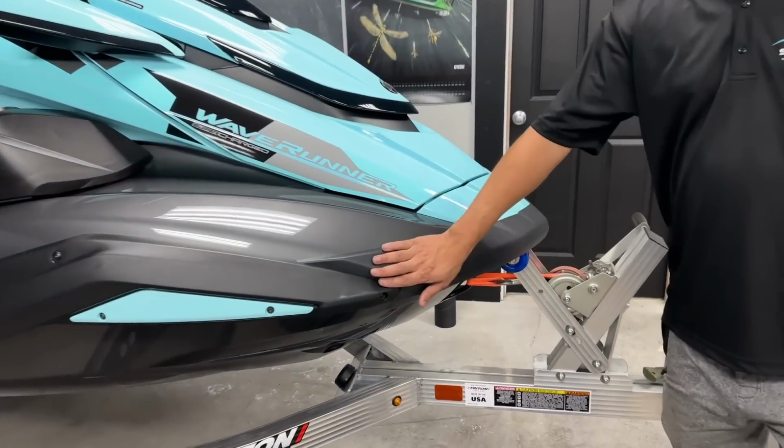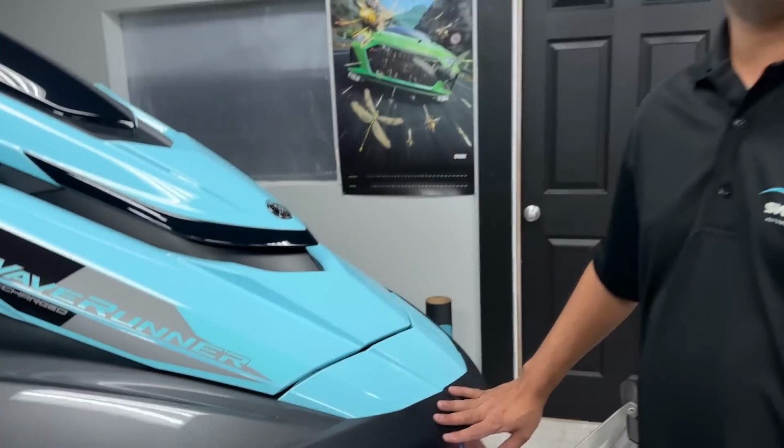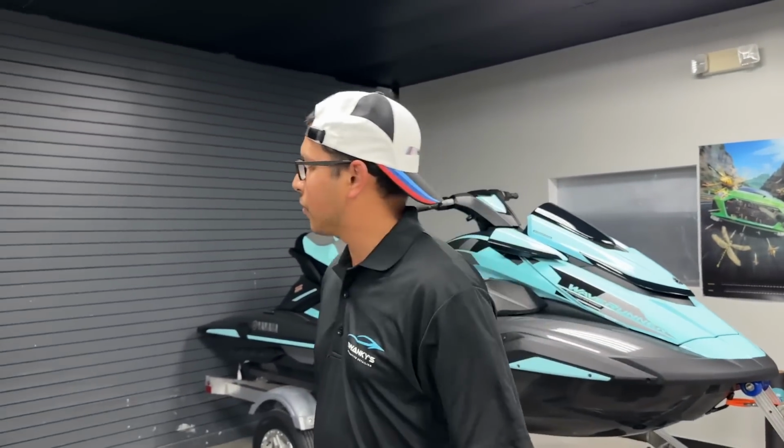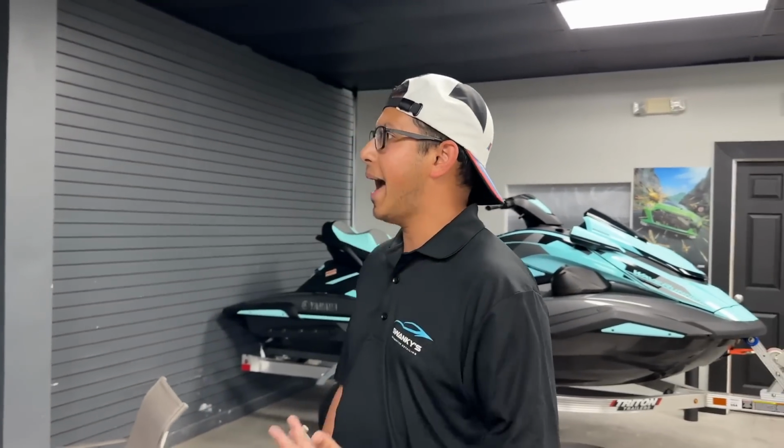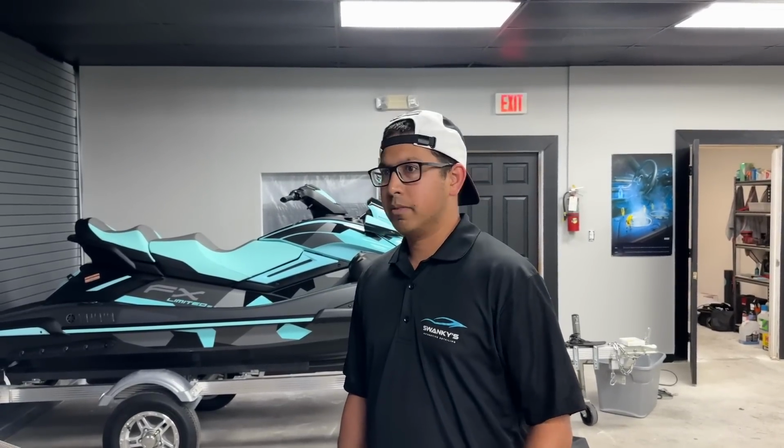So the trim's nice and deep. It's going to give it that effect everywhere, but without adding gloss. It's going to provide the same benefits as it does to a regular ceramic coating, make it easier to clean. The only negative thing is a matte ceramic coating or any PPF or any of that stuff is only good for about 2 years. So you can't put as durable a coating on, but still get the benefits from it. Yeah, for sure. Right now, Zach's just washing the car with Car Pro Reset, regular pH neutral shampoo.